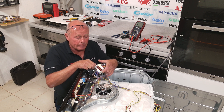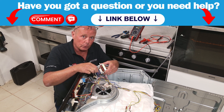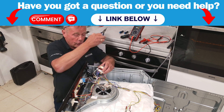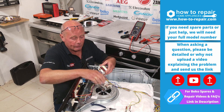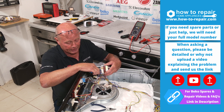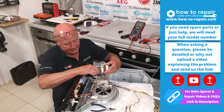Once you've taken the knob off and done the screws, you will be able to take the selector switch away. Do take a photograph. Identify each individual wire. Make sure you don't lose track of which connections they go onto the selector switch. The most common question I get asked on the website is for help with rewiring these selector switches, and on some occasions I can't help because the manufacturers will not give me the information. So when it comes to taking the wires off, just be very careful — one by one, take them off and identify them. The block connectors can be very tricky to get off; I sometimes use a small or hook screwdriver and go underneath, lifting the terminal up slowly on each side to prise away the connections. They can be very sticky — these things are not easily fitted and not easily removed.